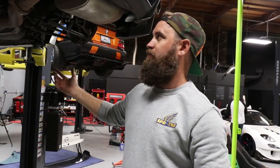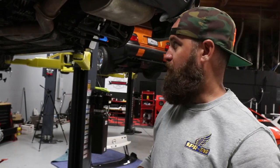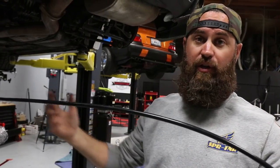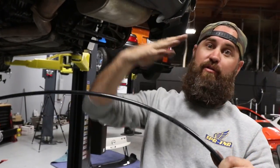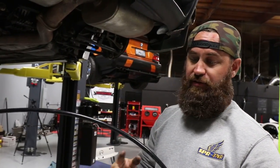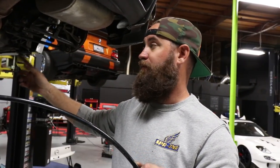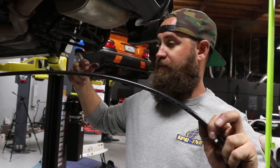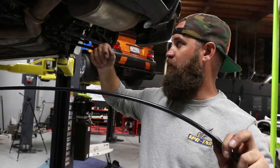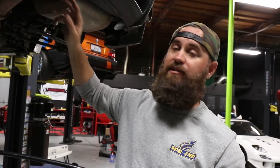When you're about three-quarters of the way back through the car but haven't sorted out where you're going to run through the chassis up to the tank, cut the line pretty long — leave yourself extra. That way, if you have to go up and over something or change something at the last minute, you haven't wasted line. Start routing the driver's side line along with the passenger side line, get them zip-tied and buttoned up, and then make your holes in the chassis for the bulkheads.